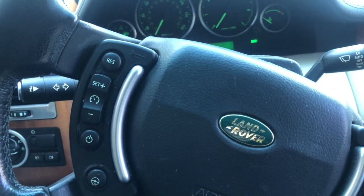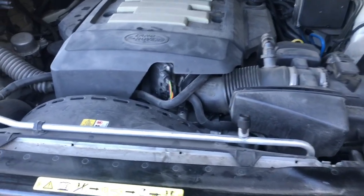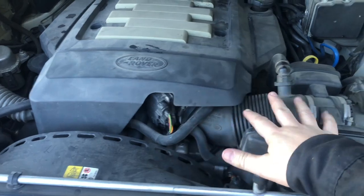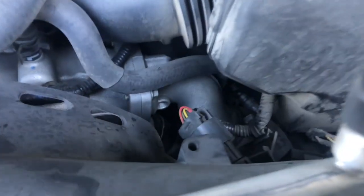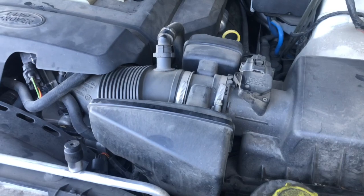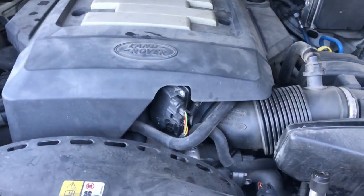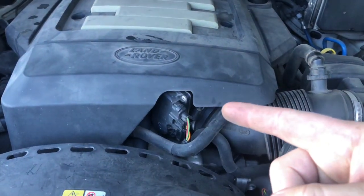So let's go for the ride and get to it. Here's under the hood — we're going to have to take the fan shroud, all this stuff off, and the air intake, because the AC compressor lives down here on the bottom right-hand side. So we got our work cut out for us today. We're going to go ahead and jump into this.